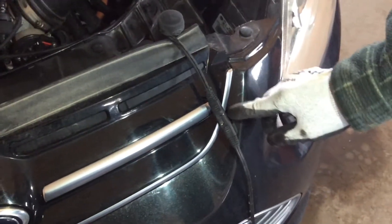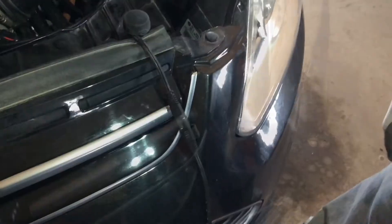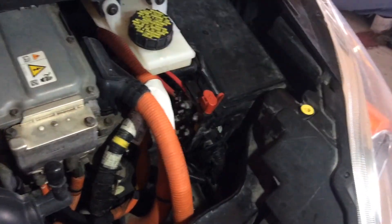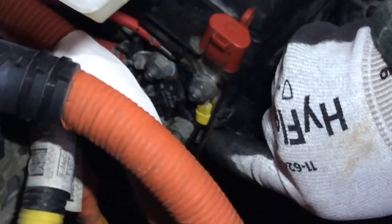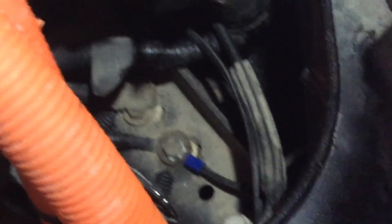Here's the part about installing a battery tender. I have the little cable coming out through the front, which you can put away after winter and still use in the summertime if the car isn't being used for a while. There's a half-inch nut on the positive terminal you can remove to attach the charger's positive lead, and then your ground goes to the factory ground, which is a 10mm bolt right on the frame rail. Apply a little anti-seize and tighten it up.